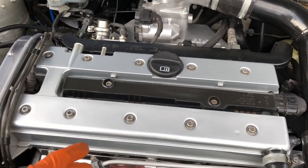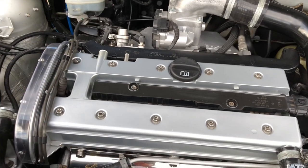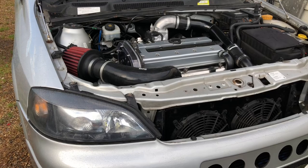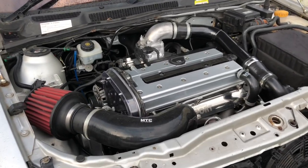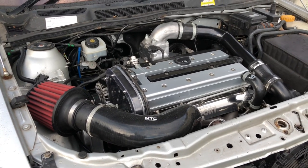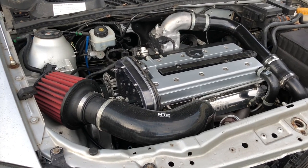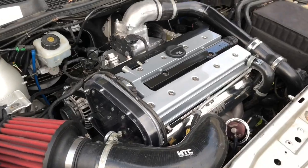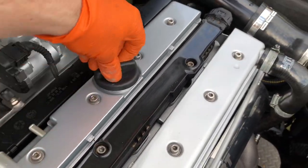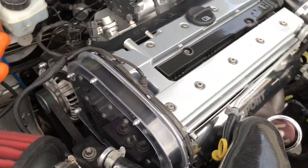There is another way if you don't want to put load on the bearings - take the coil pack out and take the plugs out while you turn it over, which takes all the load off the bearings while they're still dry. They should have assembly lube over them if it's a proper engine build. What normally happens is a person puts in a fresh beautifully built engine and damages it irreversibly in the first 10 seconds because they haven't got oil pressure up and they've damaged the bearings. Then they tell everyone the engine is crap when it blows up in a thousand miles time. Fill your engine up with the correct oil level, check it on the dipstick, make sure it's fully maxed out - it's got an oil cooler and it's got to fill that up along with the oil filter if you haven't pre-primed it.